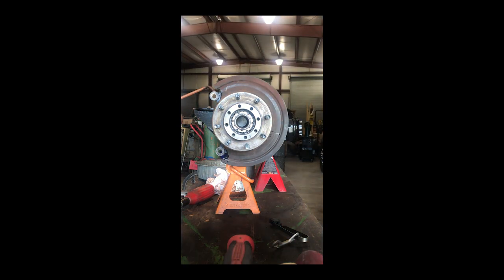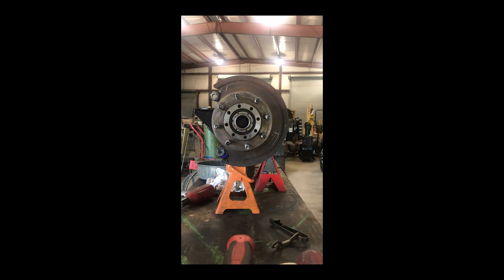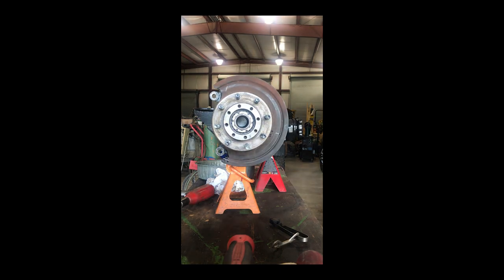Here we have a straightening of a housing. I was building this truck and putting all the four-link stuff on the housing, and it bent it — just turned it just a little bit on this side. After going and looking at it with the bar we had built up, we realized the other side had bent as well. What we have are some pucks that were put down inside and placed where the carrier bearings go for the differential.